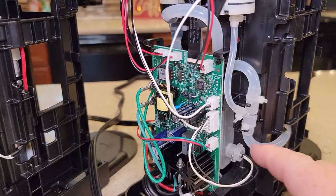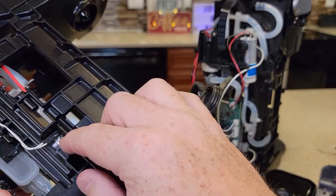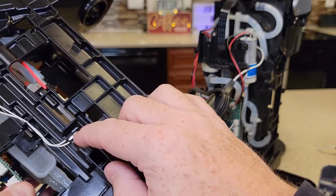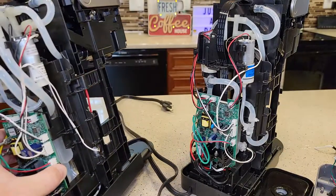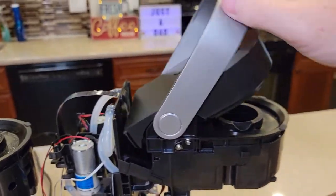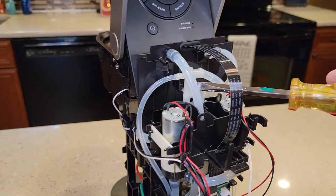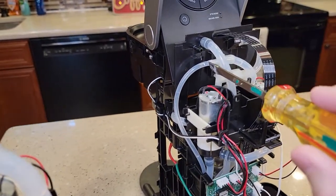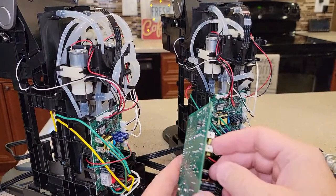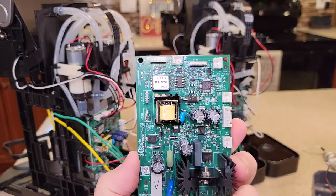This box doesn't have that pressure sensor — looks like that sensor is installed somewhere else, like right here, but that looks like that's the heating element. So that must be a sensor for the heating element. They both have a micro switch right there when the door is closed, so the machine won't operate until you have it down. You can hear that micro switch clicking right there. They both have this manifold up here with over-pressure relief, and it's got a little tube that comes off and goes to the back of the circuit card. Here's what that circuit card looks like — that little tube connects right there, and that's called a pressure probe on the card. Looks like a chip.